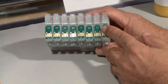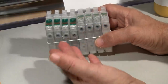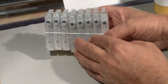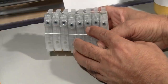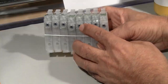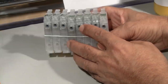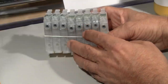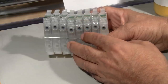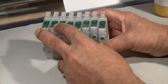Eventually that process of removing and reinserting would wear out the seal. I don't know how many removal cycles you could get away with before you'd have to replace the card, as it could theoretically lose the sealing capabilities of the exit port on the ink stem of the printer's head carriage. That port has to seal 100%, otherwise you introduce air into the system and you'd constantly be getting nozzle clogs when in reality it's just air in the system.